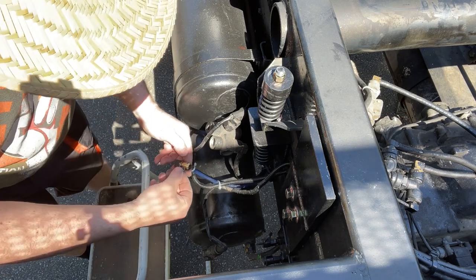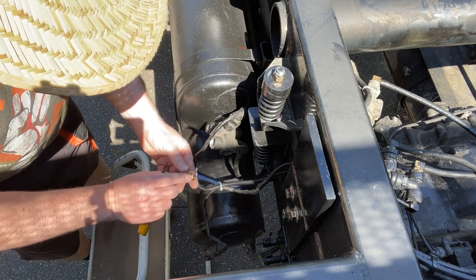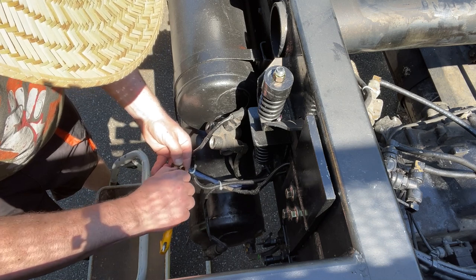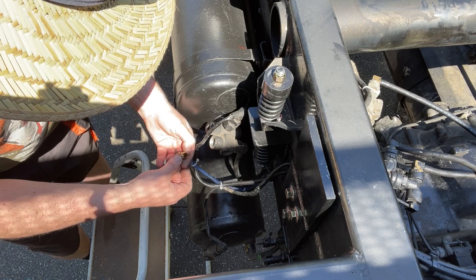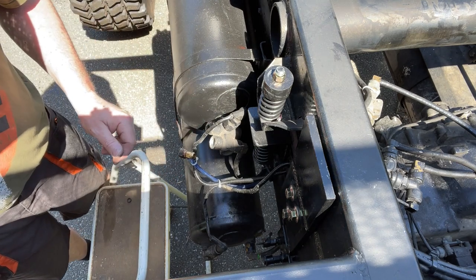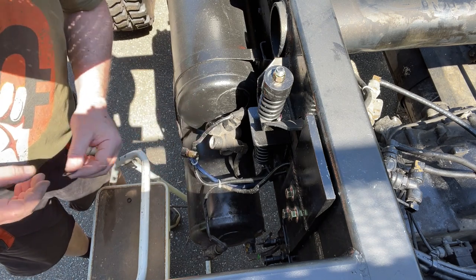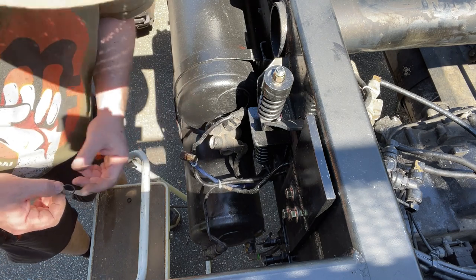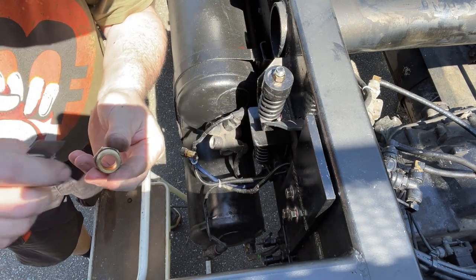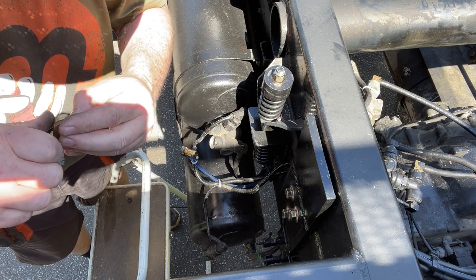These kits can also be bought at Freightliner, because Freightliner is a daughter company of Mercedes-Benz. So you can ask at Freightliner Parts if they can organize such a seal kit. I could also imagine that Freightliner uses the same type of connections, so now you know how to change a seal kit on a Freightliner truck as well. Now we're changing the seal ring on that nut — take the old one off. A small flat screwdriver would be better than a knife blade, but I don't have one here.